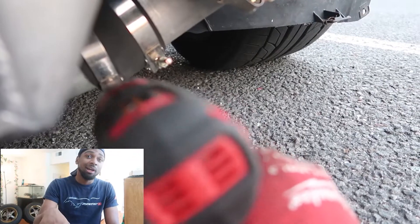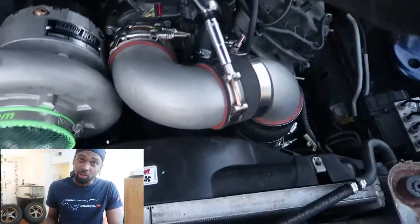The second problem, which is pretty common with Vortech and Paxton guys — and I'm not sure about Pro Charger guys — this is more of a factory kit issue. Some people see it, some people don't: the couplers blowing off. The worm clamps that come in the kits just don't seem to do well under boost pressure, and if you tighten them too much they kind of break. What you can do to offset that is buy T-bolt clamps, which you're seeing in the video.